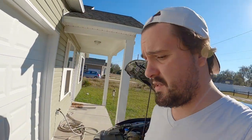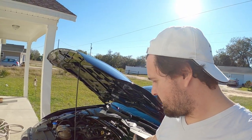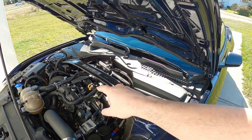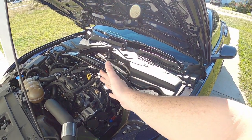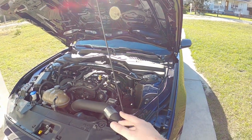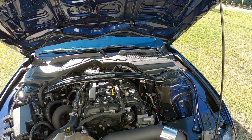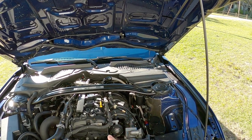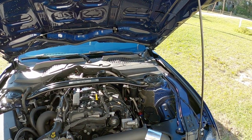I'm doing it this way because I want to showcase the ups and downs, the trials and errors, and the logic and mindset it takes to learn this. This is what you'd have to go through learning it yourself — I'm going off all the same material you'd read, learning what works and what doesn't. That's the process. Now I've got everything ironed out and the car is safe. I'm going to take everything I've learned across the first five or so revisions plus all my forum research on over-boosting, and rewrite a whole new tune. I'm not adjusting the torque tables at all — only the limiters, fueling, and TIP threshold so it doesn't throw a check engine light.